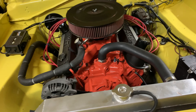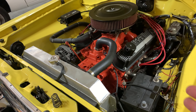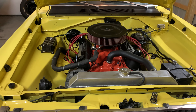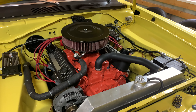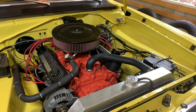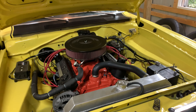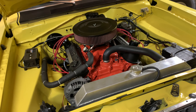I don't know if I can wait that long, so I'm kind of thinking these might go on my current engine at least temporarily. I kind of want to see what they would do. This engine here runs pretty good — the car went 11.50s earlier this year and does 11.60s consistently, just with iron J-heads that I ported at home. So I want to see if, with a smaller flat tappet cam and a dual-plane intake, these heads will actually make an improvement. The max lift is 0.600, which is quite a bit more than what this cam is making at only about 0.500.